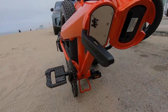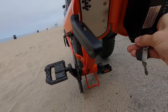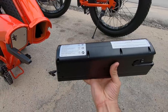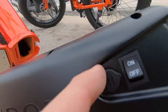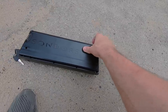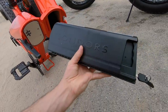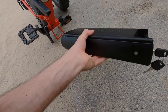Got our hands on the keys for the Fold XS so you can take a look at the battery — it's right there in the tube. We'll unlock it here and it does slide out very easily, so make sure you're paying attention as soon as you turn those keys. This is the 48 volt, 14 amp hour battery with those LG cells. It has a switch and the charging port, so you can charge it off the bike if you need to. It weighs 7.5 pounds — really not too bad for the capacity. That's one of the nice side effects of using those good LG 3500 cells.